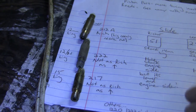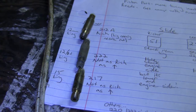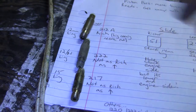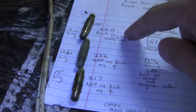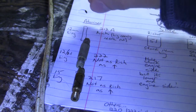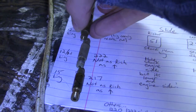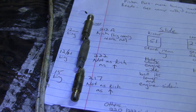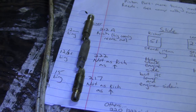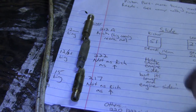Now let's talk atomizers. I've got three of the more popular ones lined up here. The atomizer can really affect your entire range, more or less. Specifically, if it's too rich, you'll never be able to get it to run right — that was my case when I had the top atomizer originally in my 14 Bing. This is the 212A atomizer. The big opening where the needle goes in is the widest of the three, which means it's a richer atomizer. This one generally came in like 1 horsepower 12mm Bings, but I bought my carburetor used and that's what somebody had put in it.